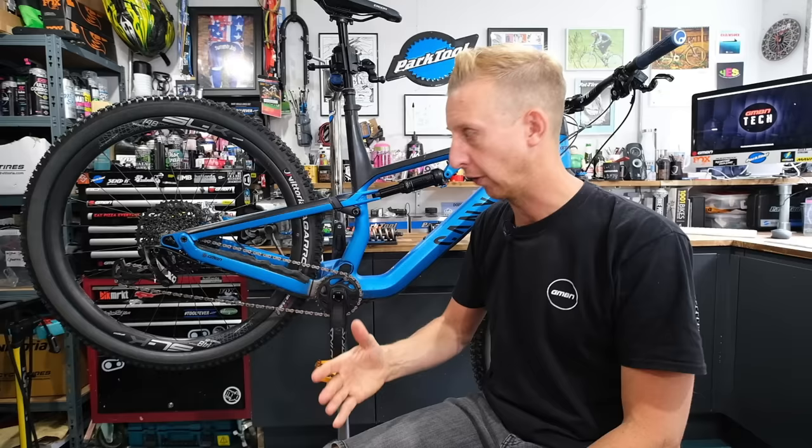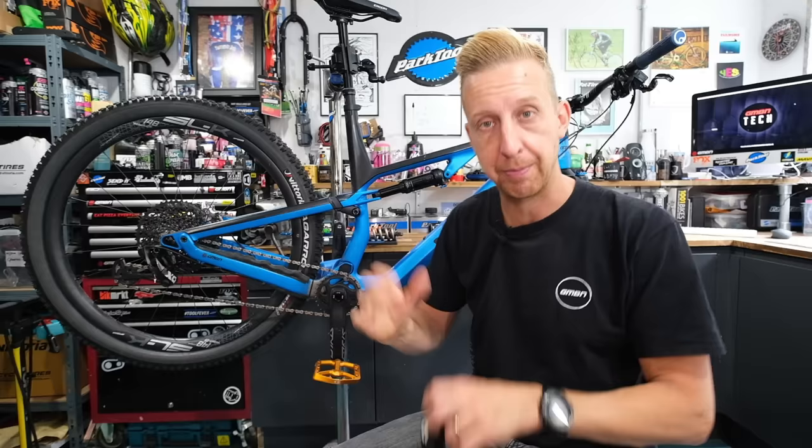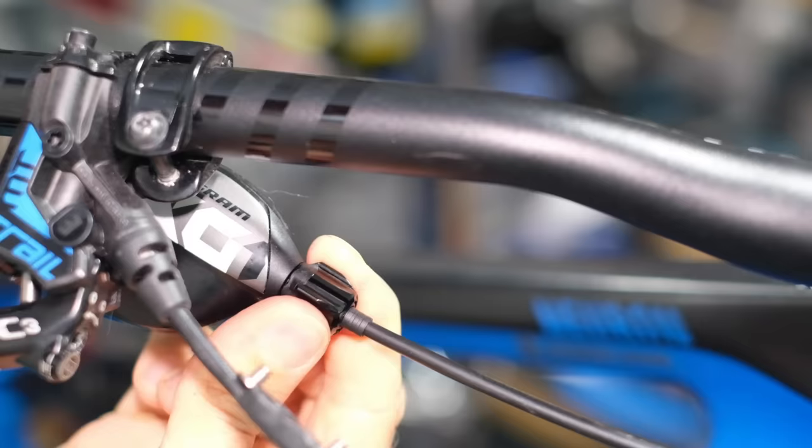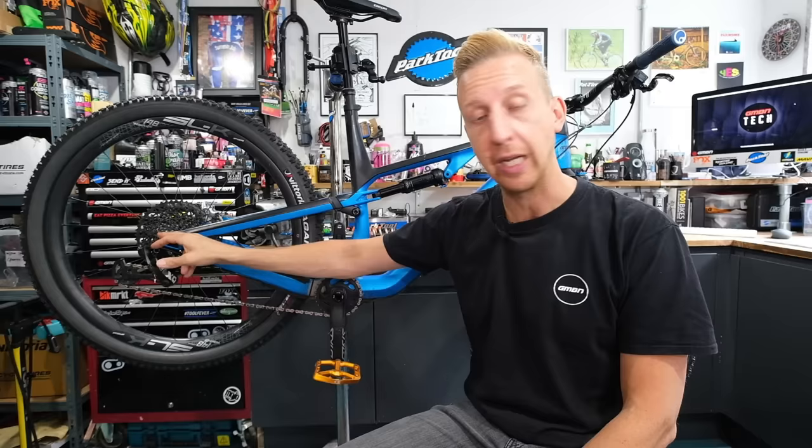The last thing to cover is constant adjustment. With any set of gears — whether using a new cable or an old system — there'll be a settling-in period. People call this cable stretch, but it's not: this is where the outer cables settle into the sheaths, housing, ferrules, and parts of the frame. As you move around on the bike and go through the suspension, everything moves around, creating small amounts of slack that you'll need to compensate for by dialing in the barrel adjuster. Rather than wasting time doing it in the stand, go for a ride, run through all the gears, and see how everything works. After a first proper ride, maybe two or three rides, you might just need half a turn or a quarter of a turn on the barrel adjuster to add a bit more tension. It's a very simple system — it works on cable tension and some limit screws. Dead simple.